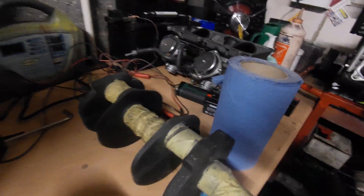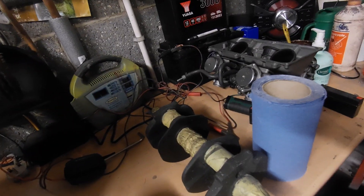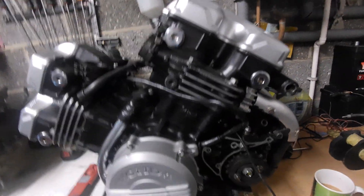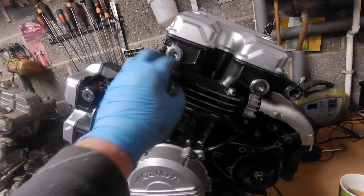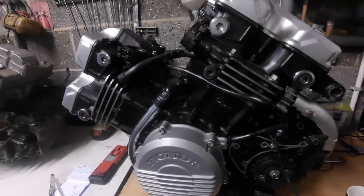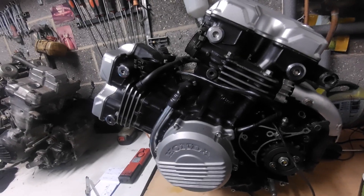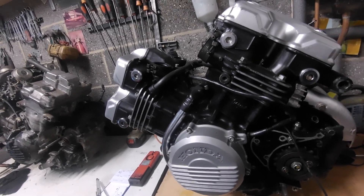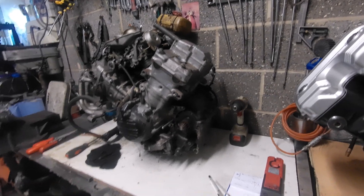To all intents and purposes, that's a 360-degree crank and that engine runs a 180-degree crank. So this crank pin is 180 degrees away from that crank pin on the VFR engine. That's why I think this motor carries its own unique sound when it's on song — it's a howling machine, these V4s. Honda did get a lot of it right, but they also got some things wrong.